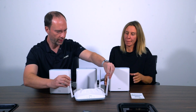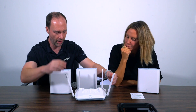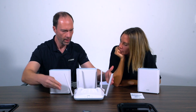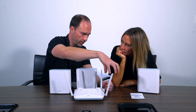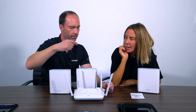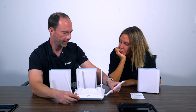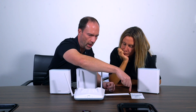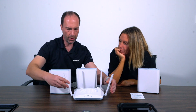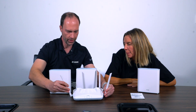And in terms of setting this up and where to put them in the house — is it all quite easy in terms of installation? We've done a few videos in the past about router placement and antenna placement. We can play around with the antennas here. What we always say is point the antennas in the direction in which you want the signal to go. So in the case of this device, if it's central in your home, think about each antenna as broadcasting a signal like a donut — the donut would be around the top of the antenna, so it broadcasts that way, that way, that way, and that way.